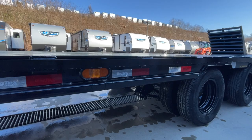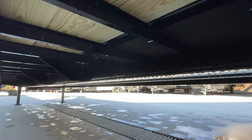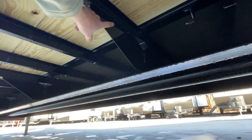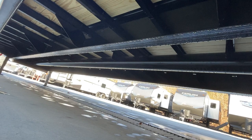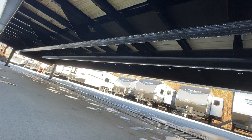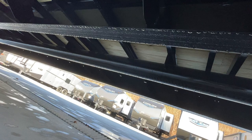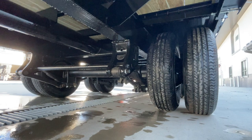I want to show you underneath what pierced beam means. There's also a mid marker light which isn't always standard equipment. Looking under the trailer, at the cross member you can see a tiny bit of daylight — that cross member is running through the I-beam instead of sitting on top. Roughly every four feet you'll notice a gusset. You can also see the big pipe running down the center — that's a torque tube, designed for off-road applications to keep the trailer from racking and twisting. About every fourth cross member has a gusset tying it to the frame, stopping around the center of the axles.